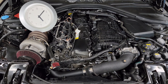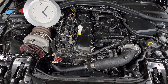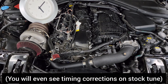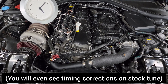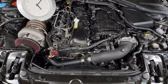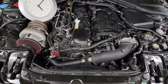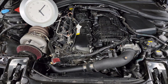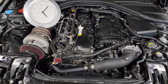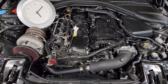The last thing, and the one that has always made the biggest difference in my testing, is gas quality and octane. Timing corrections are not the end of the world — it's a built-in safety for your car. Every time you fill up, gas quality is going to vary, so sometimes it'll pull timing and sometimes it won't. But if you want the cleanest timing possible, adding one to two gallons of race gas or E85 does wonders. If I'm running a pump gas map I might add one or two gallons of E85 and my timing gets much better. If I'm running an E30 or E40 mix I'll bump up to E35 or E45 and that makes my timing much more consistent.